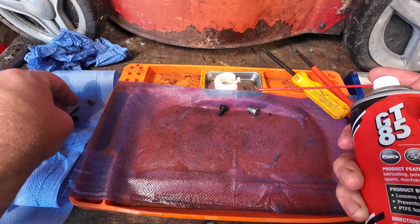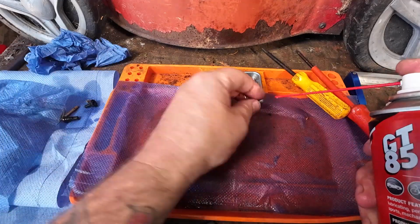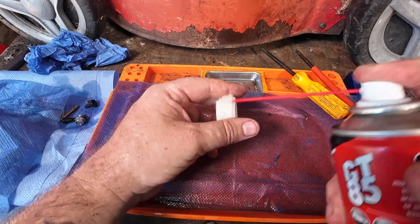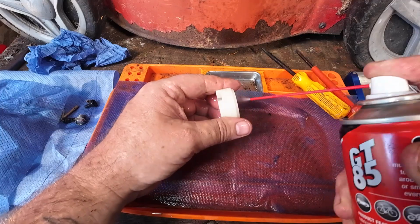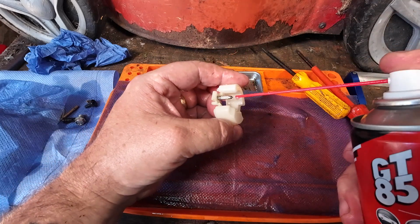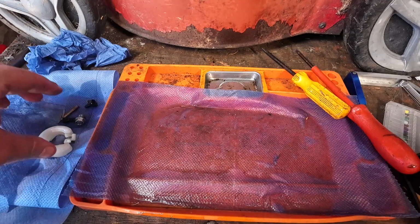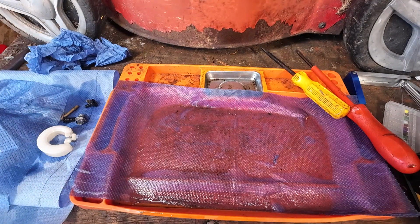Now it's working. Put it over somewhere clean. Give that a clean. Bolt can have a bit of a clean. Needle and float. Again, a clean. Just get rid of all the ethanol that's on the float. Isn't that a beautiful thing? Just inspect the top of the needle. It looks to be good. It was holding fuel beforehand, so that won't be a problem. I'm going to wipe my hands down. So that's the carburetor now cleaned.